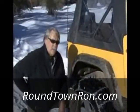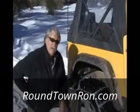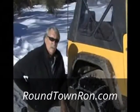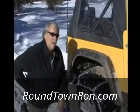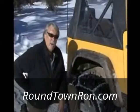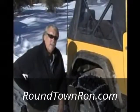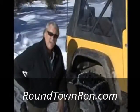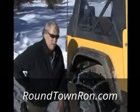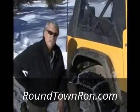It also makes it much easier, even on a packed trail like we're on right now. The chains make it easier to drive on that trail, give you a little bit better steering control, better braking control, and it's much better going up and downhill. So be sure to carry at least 1 set, but preferably 2 sets of chains. The P-WAG square link chains are excellent. This is the first time we've tested with those, and we're very impressed with the performance.